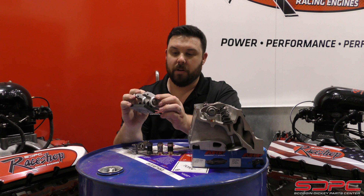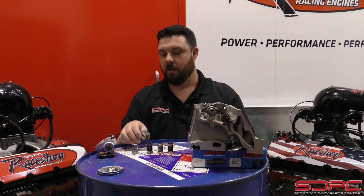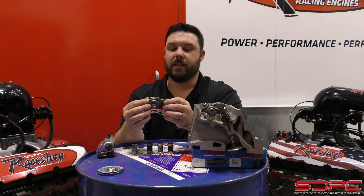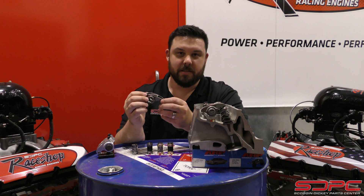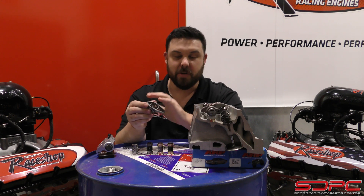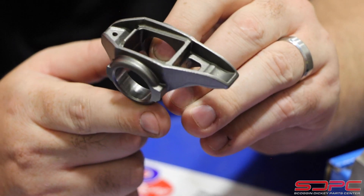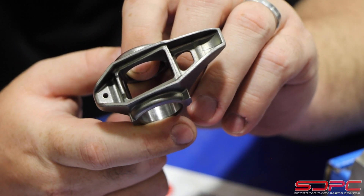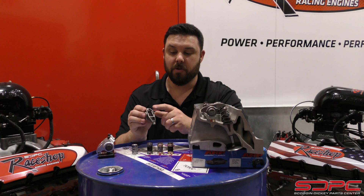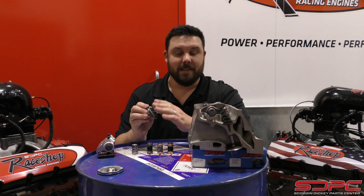These are very high quality, very racy stuff. But when the LS came out in the 90s, they came out with this style rocker arm. This is an LS3 that I've removed the guts on — these are investment cast steel, really high grade, really high strength. We almost see zero failures in these when it comes to the rocker arm body itself. They're actually pretty trick. All the weight is carried in the trunnion, and you can see they have a lot of bracing on the nose and on the tail where the push rod goes, to keep valve train stability at its highest.